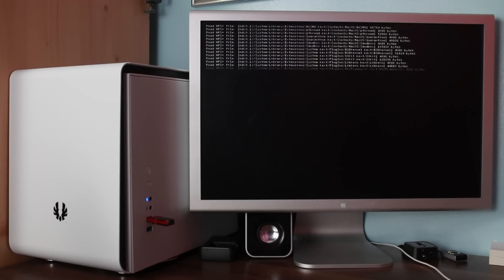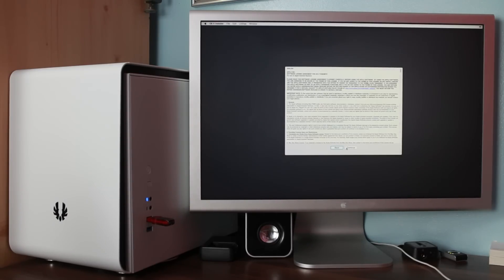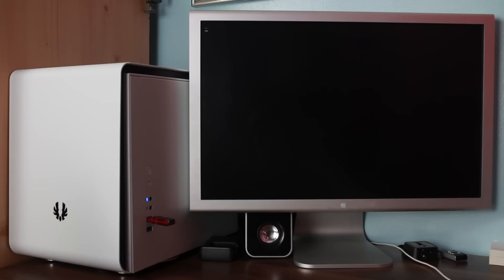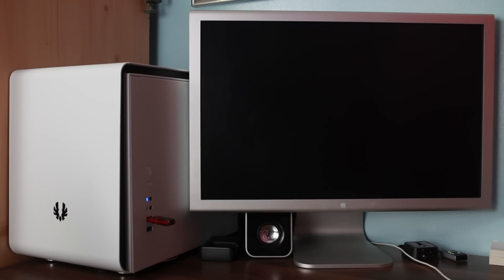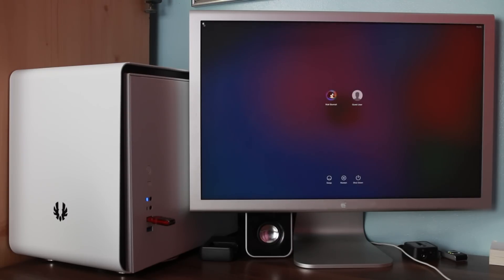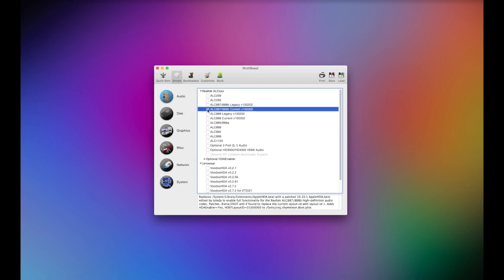And as you can see, it did work. I went about installing OS X Yosemite as I would on any Mac — there was nothing different about it whatsoever. After it completed, obviously reboot. We need to leave the USB stick in though, because there's no bootloader installed onto the SSD yet. Boot back into the USB stick. I tried without any boot flags this time — just went for it — and unbelievably it worked. I was getting a couple of freezes every now and then, so I used the boot flag -NO-ZP. I don't know what it does but it fixed my issue. Audio didn't work, which was the only thing that didn't work — pretty good going when you think about it.